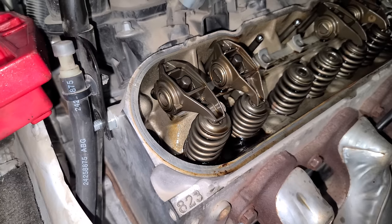The reason we pinned the crank is because we added this big blower. That is going to cause drag, more resistance, and it could actually spin the harmonic balancer on the crank, which would destroy it. Some engines have a factory keyway. This one does not. So we added the pin so the balancer won't spin on the crank and cause us to have a really bad day. Sometimes you can double pin it as well. But in this case, Procharger sends out the tool for a single pin, and that's been tested and proven to hold up really well. Right now, Taylor is spinning the engine.